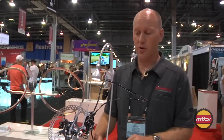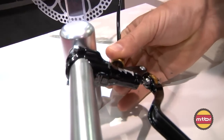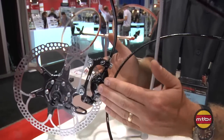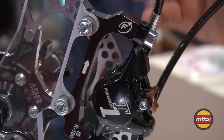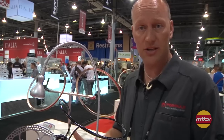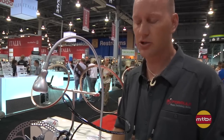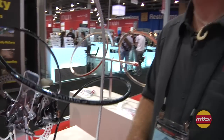We also have our T1 brake, which is one of our more adjustable brakes. It comes stock with the tool-free reach adjust. It also has the FCS adjuster, which is going to be your pad contact point or your overall feeling of your disc brake system. This year, in addition to the ECT enhanced caliper technology that we've put into all of our calipers, the T1 caliper saw a little bit of a makeover because now we're running the line on the inboard side of the caliper instead of the outboard. We found that gives us a little bit smaller, more compact disc brake caliper, which is going to be stronger and stiffer. It also improves the way that the line actually routes up your chainstay or your seatstay. It's a really nice, clean mounting position. The bleed port is on the inside of the disc brake caliper, but bleeding is still a cinch because you can get in there just fine with our regular bleed systems and a short straw on the syringe.